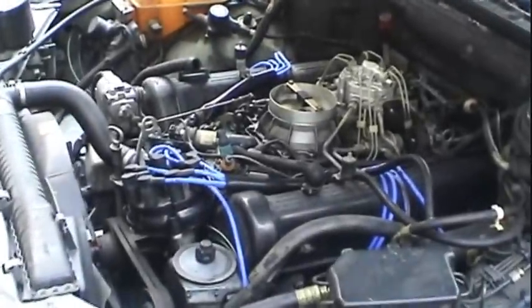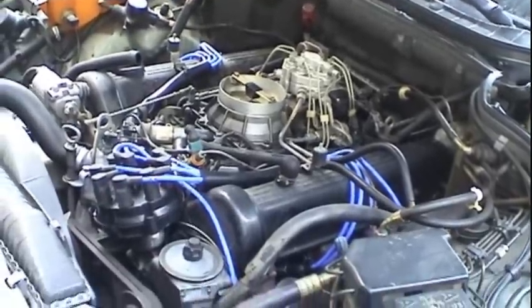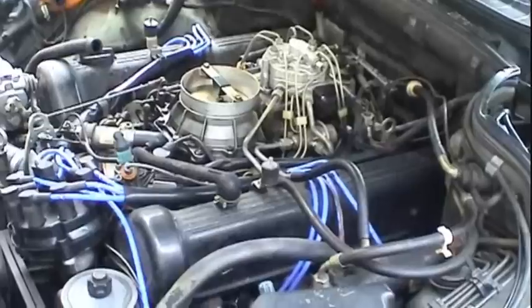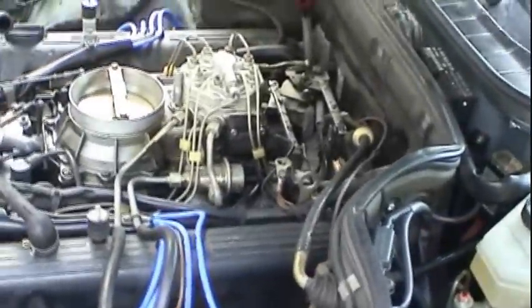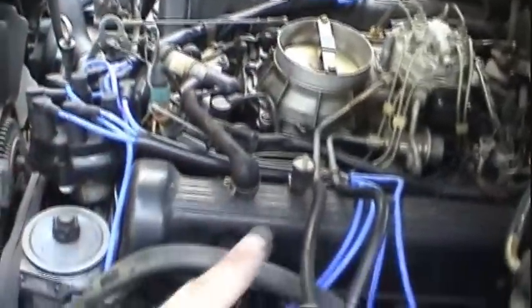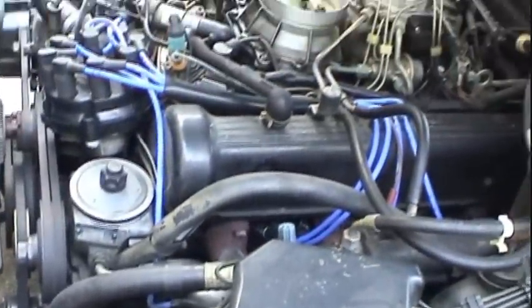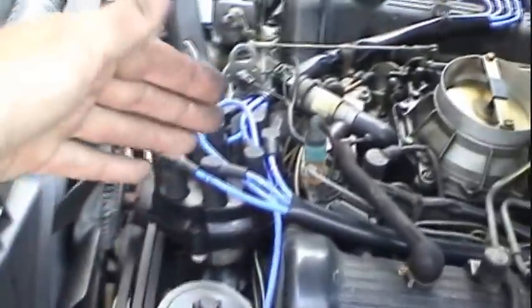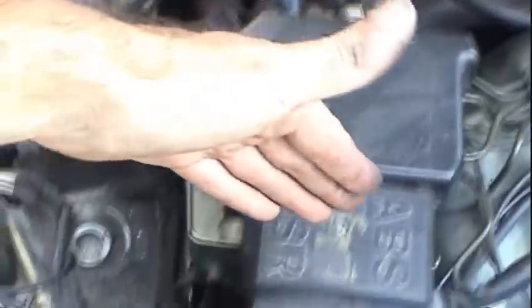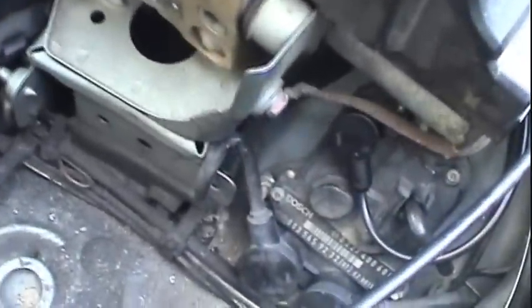Regular standard petrol engine, you have to have air, fuel, and spark. So without one or more of those things, without all of those things, the engine's not going to run. So we kind of methodically went through and made sure we had fuel, and made sure we had air, and then made sure we had spark, and spark ended up being where the problem was. And then it was just a matter of starting toward the front and working our way back through the entire system to try to find out what the root cause was, and that ended up being a failed crankshaft position sensor, which I never really have seen before.